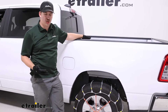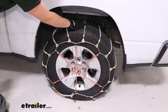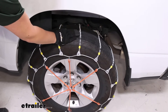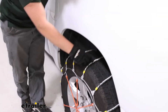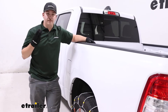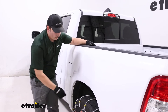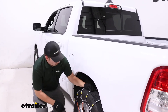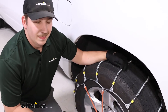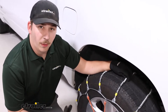Now these are a cable-style chain, and like we mentioned, they're not the most aggressive thing out there — you can really see once it's on the tire how low clearance it is. These cable chains are great for smaller vehicles, or on your truck too if you're in a very light-duty situation. If you do need something a bit more aggressive, there are plenty of other options: twist-link chains, square-link chains, and a V-bar-style chain — those are in ascending order more and more aggressive, better for ice. This will be better for light snow. The rollers over top of the cables here are going to give a little bit more height, and they're going to be a low-carbon steel construction. That low-carbon steel is a softer metal and might not hold up as well over a long period of time, so just be mindful of that when you are picking them up.